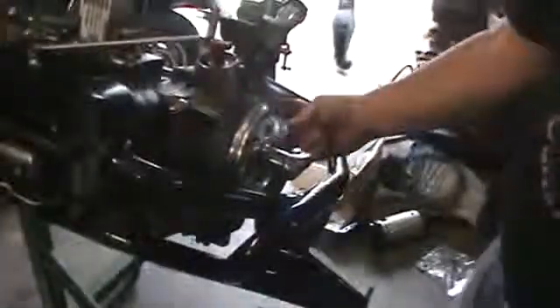We've got our distributor in. I've got to dig up a clamp for that, but we're all good to go there. That's how I put the drive gear in. I marked the distributor for number one. We rotated the motor — it's on TDC. We lined up with the case halves. The intake valve was closing when we came to top dead center, so we should be good to go.